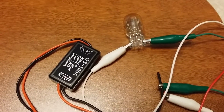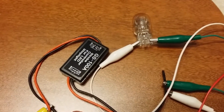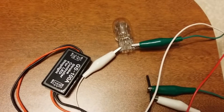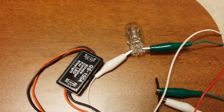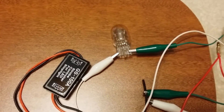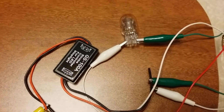A few people have asked if the GS100A strobe controller for LED stoplight will function with an incandescent bulb. The answer is yes, it will drive a single incandescent bulb. Any more than one or maybe two bulbs, and the amperage is way too high for the controller. The other issue with incandescent bulbs is their flash rate is not fast enough for the controller, so you miss the first four quick flashes.